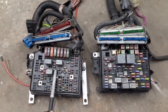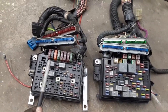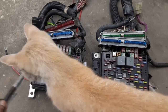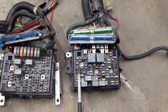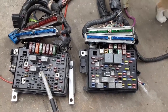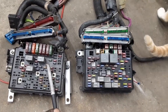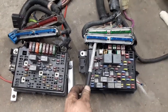Here are the two generations of Gen 3 wiring harnesses. On the left is the 1999 to 2002, usually called the blue and red connector or the 0411 PCM. You can identify them by these large fuses across the top. Over here is the 2003 to 2006 truck wiring harness and fuse block — the fuses and layout are a little different, with some relays in different spots. The pinouts are pretty much the same, so if you're using this harness, get this fuse block.